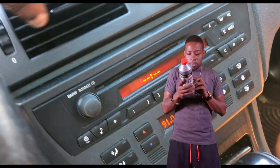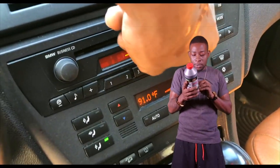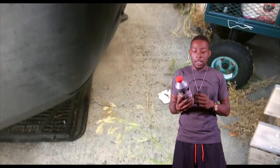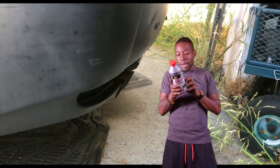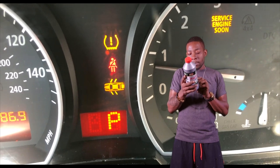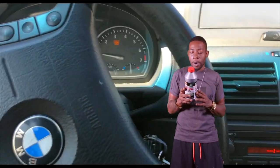Step three: top off radiator. Add coolant as needed and either run engine on a high idle — approximately around 1200 RPMs for a vehicle with a tachometer — or gently drive the vehicle for 15 minutes, which I did. I drove to the donut shop and back, which is roughly around 15 to 20 minutes. Step four, lastly: top off radiator and leave Bar's Leaks head seal blown gasket repair in the system for continued protection. Drive vehicle as normal. Most leaks seal instantly — which mine kind of did. But some can take additional thermal cycles, which happens over a few days of usage. Thermal cycles mean your engine getting hot and then cooling. People use this one time and give up and say it doesn't work, but you've got to give it some time.